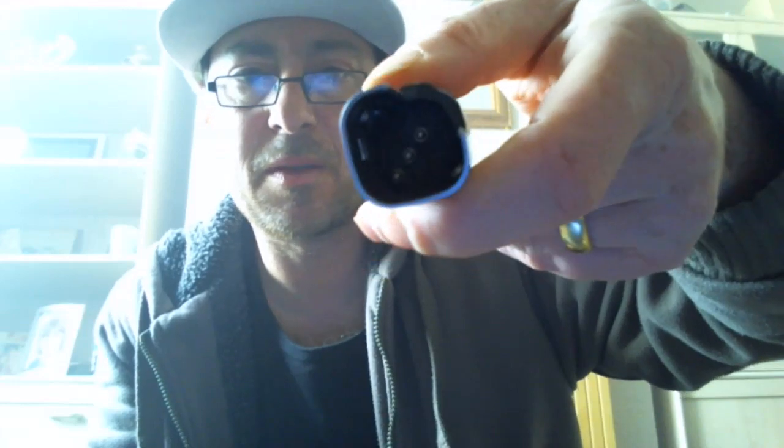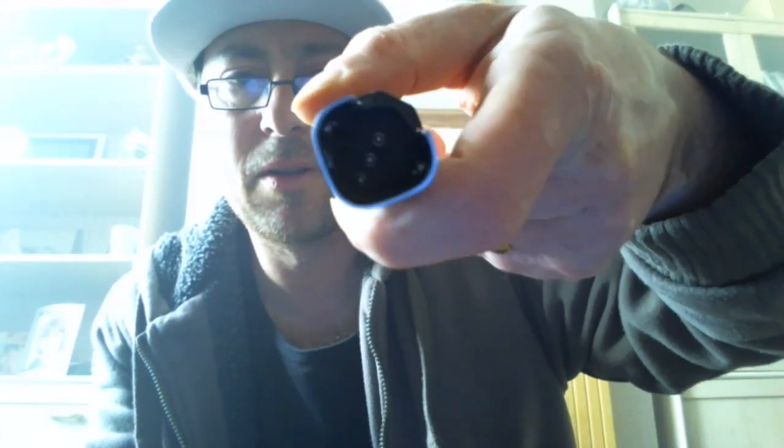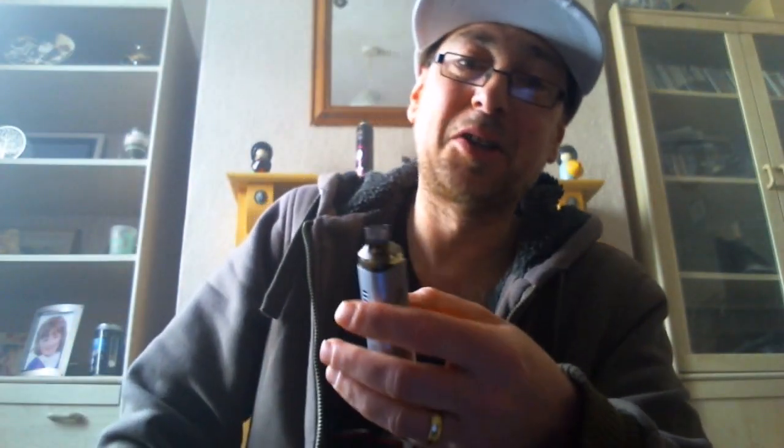That raises a problem because looking around here, there's no vent system. If your battery decided to have a problem and go for it, there's nowhere for it to vent out of. And also if you've got a little bit of juice on your fingers you can't take the bloody pod out. There's no venting for that battery whatsoever. There should have been at least something around here to provide a small vent hole. There's a 1000 milliamp battery in there - it might not sound a lot but you don't want it sizzling in your pocket should there be a problem with the protection system or anything like that.